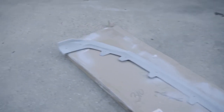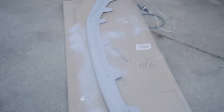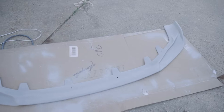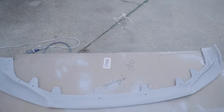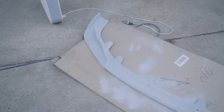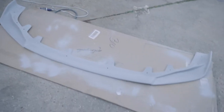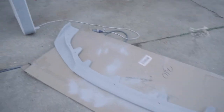As usual it didn't turn out as best as I want — it's not as coated as I thought. Maybe I should use my adhesion promoter, or maybe it's just too windy. I'm gonna wet sand it with 600 grit and see how the paint looks, and maybe do another coat of primer another day if it's that bad. Painting is something I really want to get good at. I've been trying to paint for a while but it's never turning out great. So just bear with me — if you have any tips, I'd love to hear them in the comments below.